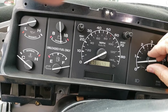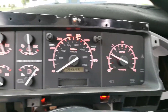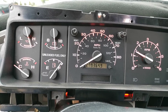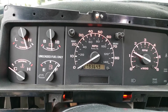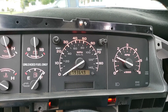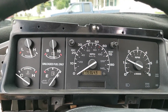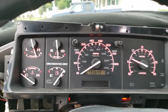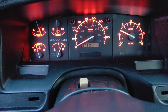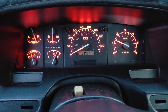Let's see - hey, there we go! We got the red gauges! Beautiful! Everything works. Oil pressure looks a little high - I'll let it warm up and see where the temperature goes. The volts look close to right. The tach is telling me it's idling at 1500 rpm which I think is wrong. Turn the lights on - everything's red! Love it! With the lights on, the whole dashboard is just awesome.